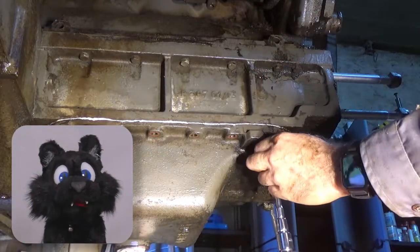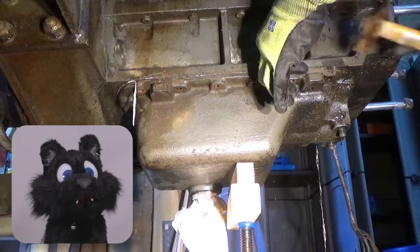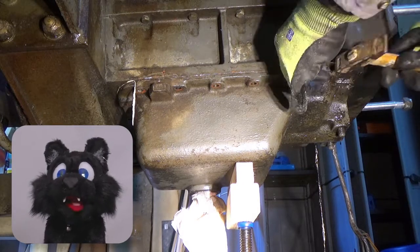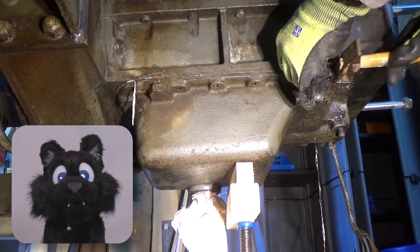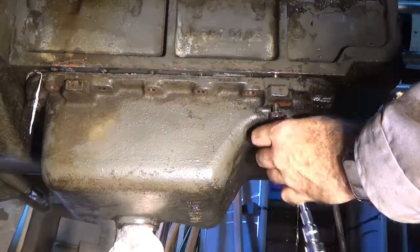I can now finally open up the oil pan. After trying some creative ways of gaining access, I discovered two threaded holes that would allow screws to push open the pan. I could not see much from underneath, but I discovered the reason the oil was so low was probably that the dipstick was bent. I always thought that's how it should be, but it should actually be straight to dip into the oil.